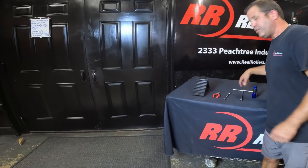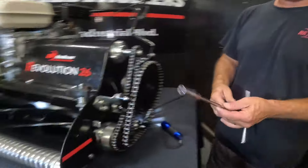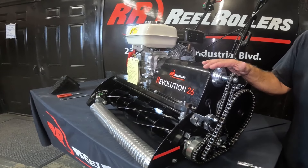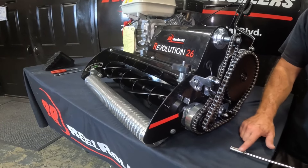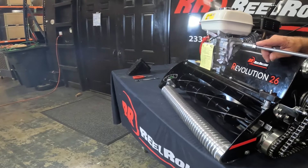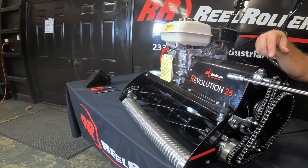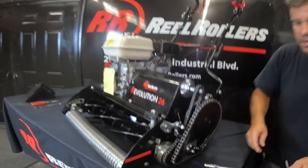I've also got a little chuck I'm going to use to block up the mower underneath the bed knife, because I want the roller to be kind of free on the front. Using the box end of the T-tool as my gauge, I'm going to put it under the bed knife on the chain side of the mower and lower the mower so the bed knife sits flat on top of it. Then I'll go to the other side and see if I can slide the socket back underneath the bed knife in the same location. If I can't, that side is lower; if I can and see a bunch of air, that side is higher. It's not scientifically precise to the millimeter, but it'll get us really close for the average homeowner.